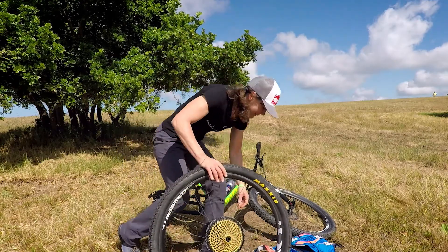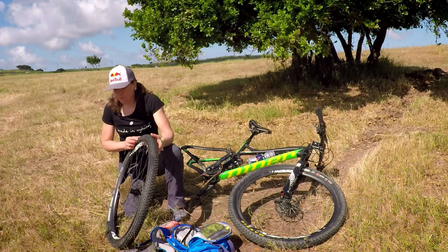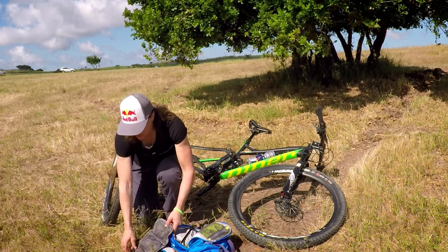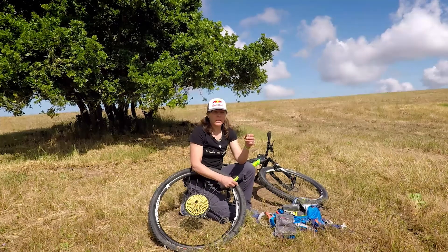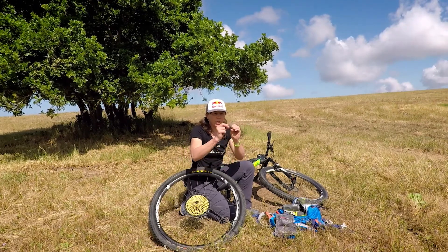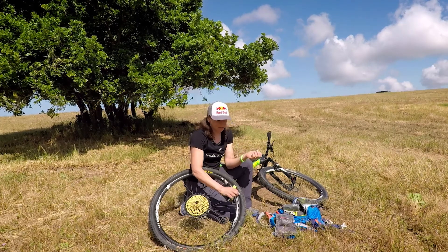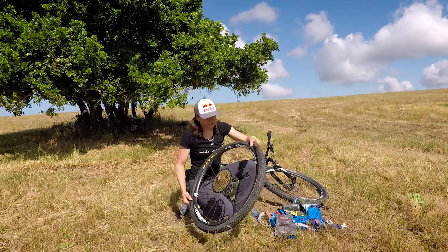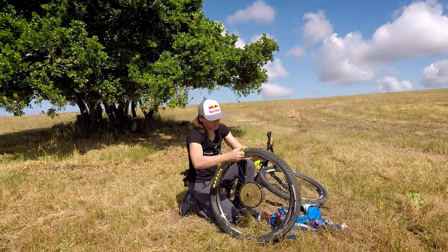Now on to changing the tire — we're imagining that this is flat. You've got to get the tire off first. If you have sealant in there, it's fine, you're just going to put a tube in, but it's a little messy. I like to keep my tools and all my tire-changing stuff organized in my CamelBak. A couple of cool little pieces I carry: if you do have a small sidewall tear, you can sometimes fix it without putting a tube in by using these little tire plugs. You thread this little sticky thing through the hole and pull it back out — a quick fix if you're racing or really charging. If it's too big a sidewall tear that won't work, but for a small one these things are pretty magic. So to get the tire off, use tire levers — stick it underneath the bead, spin it around, and your tire is going to come off.